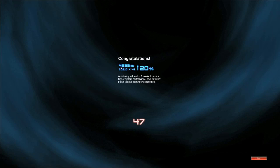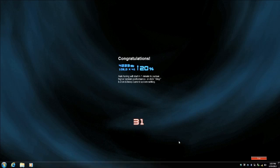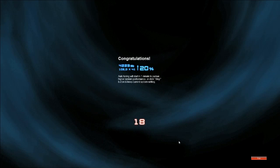We can see right here it's already alerting us that we've successfully completed the baseline overclock — at 4.2 GHz — and I like that it says 'Congratulations.' You want to feel good about overclocking your board! At this point we could click the Stop button, but we're going to let it continue to scale. The reason for the timer is that depending on your operating system environment, we don't know how many programs are loading — generally about one minute gives services and things time to load in the background, so we don't abruptly cut off the system.